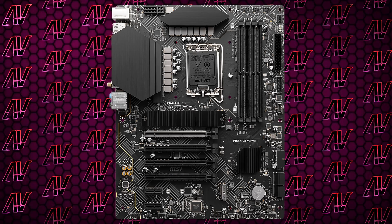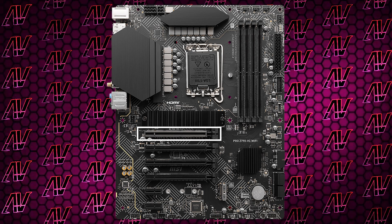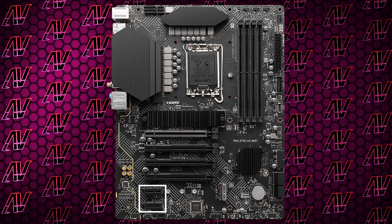What is the standard feature, as you can probably guess just by looking at the thing, is the amount of PCIe slots, with 6 in total. However, while the primary PCIe Gen 5 slot is x16, one of them is just x4 Gen 3, and the last two are just x1 — not to mention the two tiny little x1 slots for good measure. That means that if you have a system with a lot of expansion cards, which I don't imagine for a lot of people in 2024, but still, this is definitely a motherboard for you.